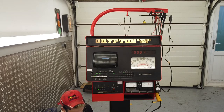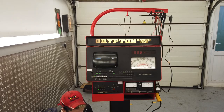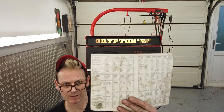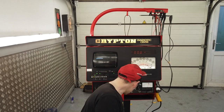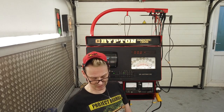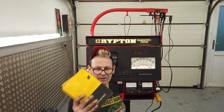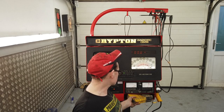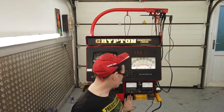Carburetor, coil resistance in ohms, 1.3 to 1.6, battery capacities in amperage, starter lock draw, alternator output, 14 volts target. So really there's not a mega amount of data in them. But they're there anyway, and really having all these books here like this is no real particular advantage, because there's only really one page you're going to be looking at, the same throughout all those books. So effectively putting them there isn't really any use for me. I'd be better off with the Haynes manual.